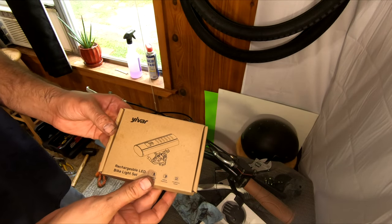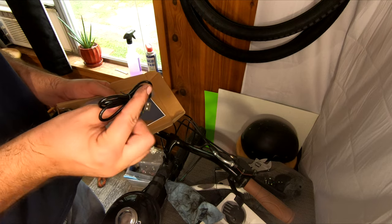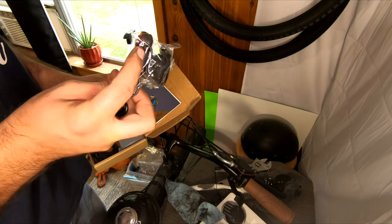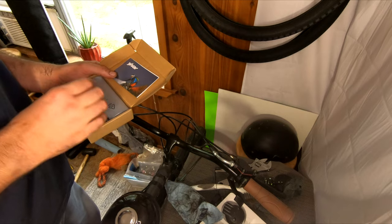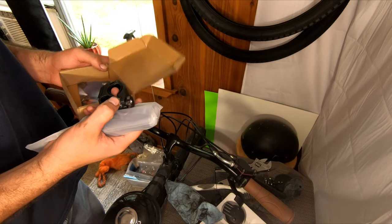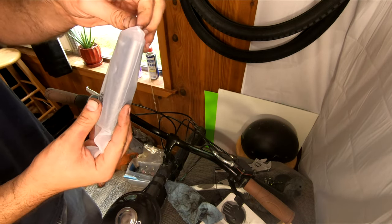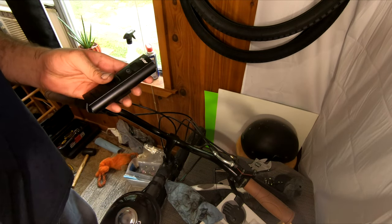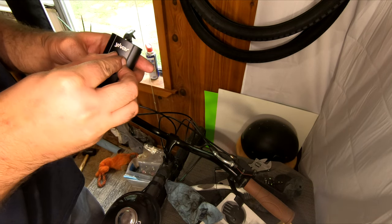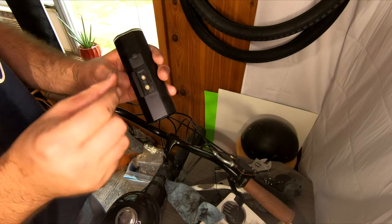It's easy enough to find a decent quality set of bike lights for around $25 to $30. On motorized bikes, anything under $50 just doesn't tend to last very long, especially the front light. They're very susceptible to vibration - they have big batteries and are heavy, so they bounce around all over the place on the handlebars, which plays hell on the mounting and the electronics. A good tip to help the front light survive longer is to simply take it off the bike during daytime riding and put it in your backpack or a bag mounted to your bike, like an under-seat post bag or one that fits on the triangle in front of the motor. That way you'll always have it when you need it, but it won't be vibrating itself to death on the handlebars.